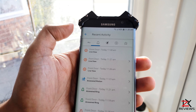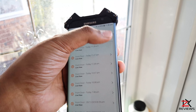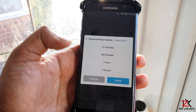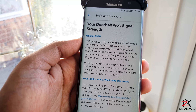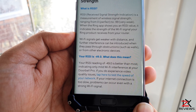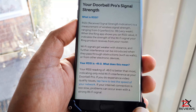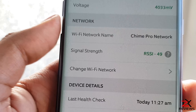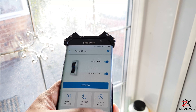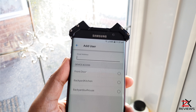Let's briefly look at the app. Event history shows you all the notifications — doorbell answered or missed, and motions. You can view all videos and highlight them too. You can snooze the motion alerts for a few hours or completely turn them off. In device health it will show you how strong your Wi-Fi connectivity is with the device — the lower the number, the better the connection. Mine is currently 49 which is good, but it dropped to 35 when I increased my broadband speeds to 100 Mbps download and 6 Mbps upload. The motion sensitivity and zones can be adjusted as well as placing a schedule. With the chime installed you can turn the chimes on or off via linked devices.